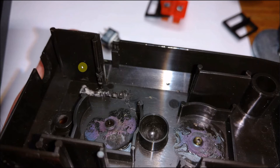When you go to bring a wire in, you have to have it underneath. And if you put your wire underneath, you have to remove the whole screw and switch if you ever have to change your wire harness. By putting it down low, the wire harness does just fit over the top. And if you ever need to change your wire harness, you can without removing your switch.